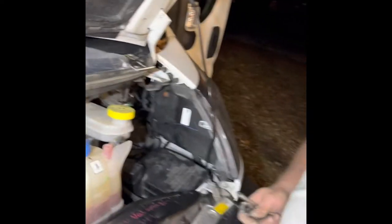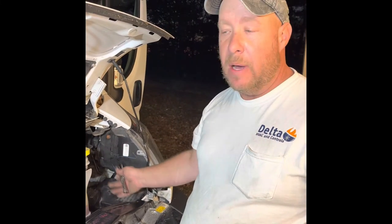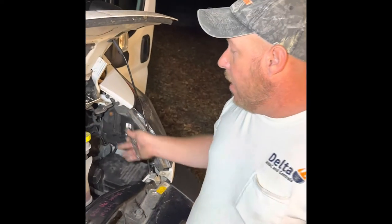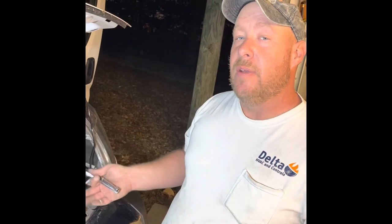Basically, the way this guy works, you give it 12 volts positive, 12 volts negative, or the negative ground, sad cable, positive cable, happy cable, whatever you're gonna call it, hot and negative. The two wires land on there. You set it on the intensity you want. As long as the vehicle's battery is above 11.5 volts, it'll operate. When it gets below 11.5 volts, it'll turn itself off to save your battery. When you start the vehicle up and it sees the alternator's charging, it'll automatically turn itself off. When you stop the vehicle, it'll automatically turn itself back on.